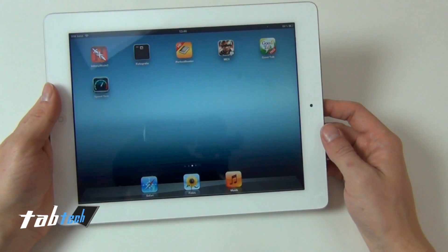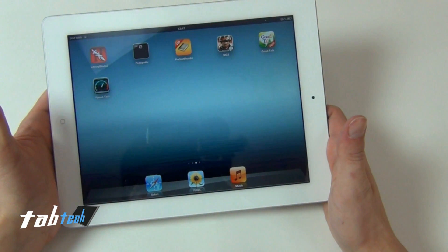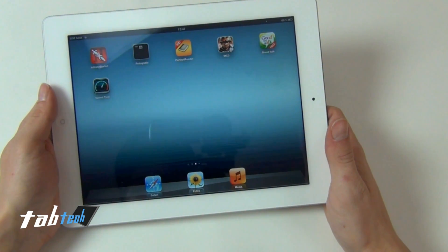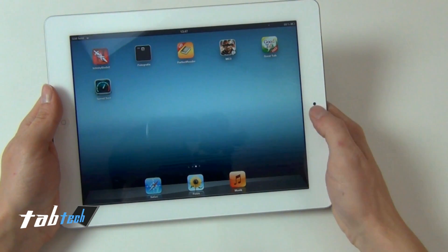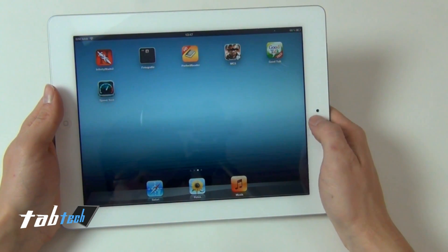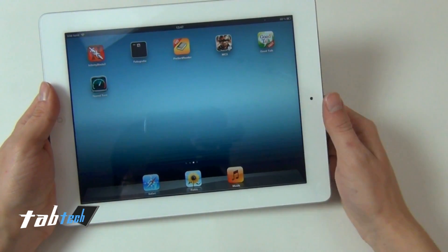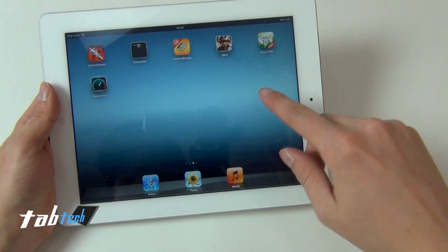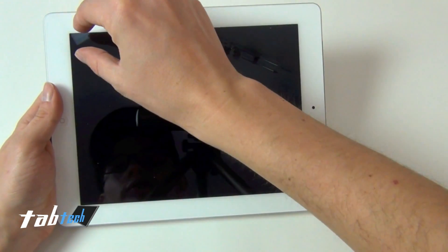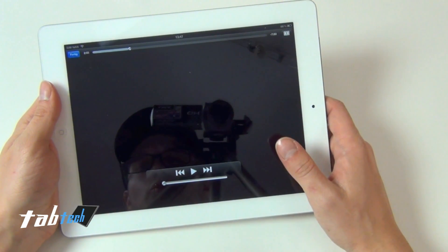Let's go to the next problem I found out within one day of testing. It's the display. All IPS displays have the problem — or most of them — that they have those display bleed areas. That means you have an area where the backlight is brighter. You can see it just on a black background; you can't see it when you're working or playing games, but you can see it when you watch movies, when you have that black stripe at the top, or if it's just black like the boot screen or whatever.